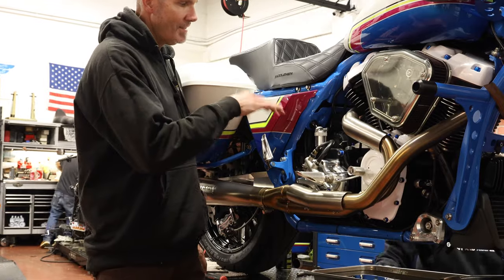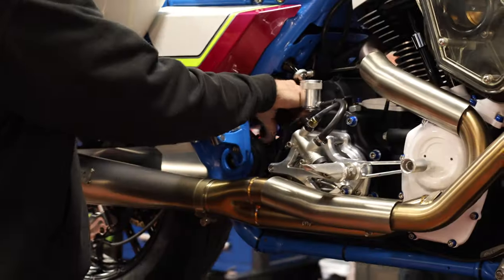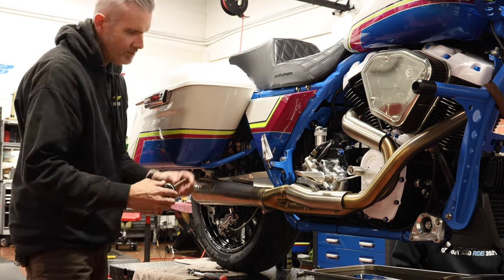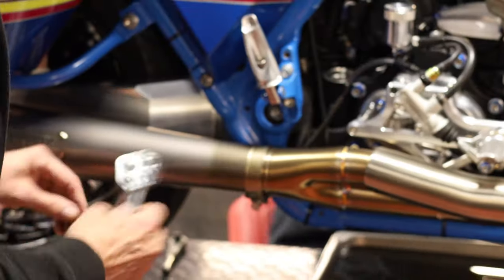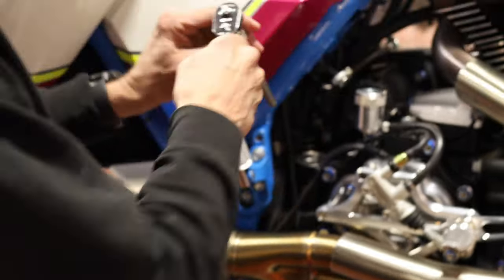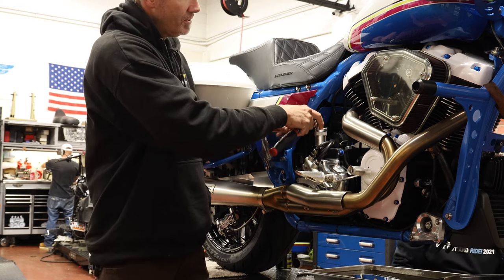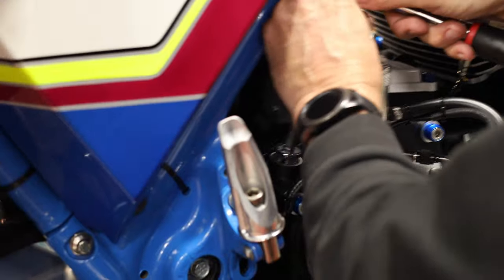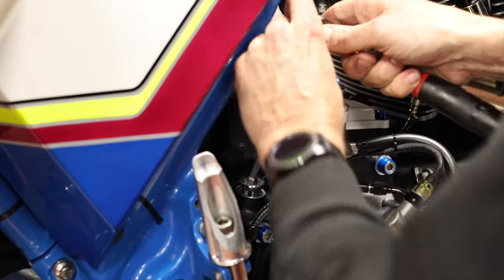Over on the right-hand side of the bike we've got our oil dipstick right here. Go ahead and pull that out. Baggers have two measuring points — on the upright and on the jiffy stand. We'll take our three-eighths ball allen — with the angle you can rotate it a little bit. If you're in a tight spot, Tony's got one of the Alloy Art stabilizers there, which makes it easier. That seems to be ready to fill once we put our drain plugs back in.